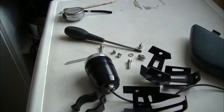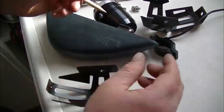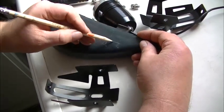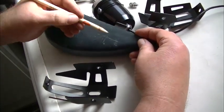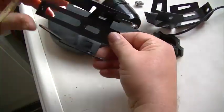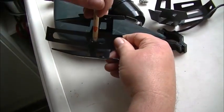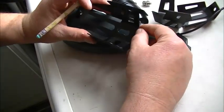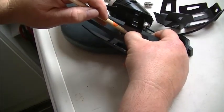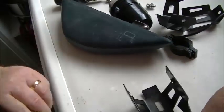Go, that's it all dismantled. Okay, as I did earlier and described, from there to there 25mm, so I've just come 25mm, drawn a line, and we're squared down. So this is where we're going to mount our screw. So what we'll do is we'll match the back end of there and this outer line with that. Just hold it flat down. Just draw and mark the line.